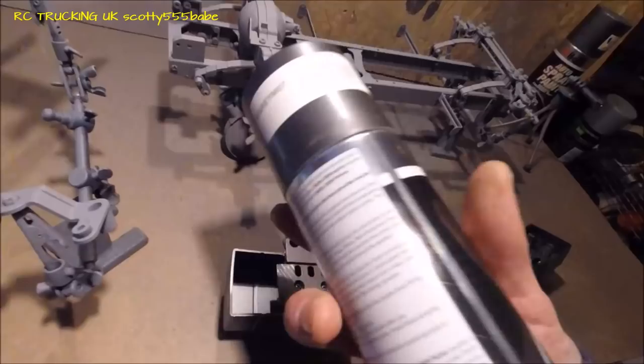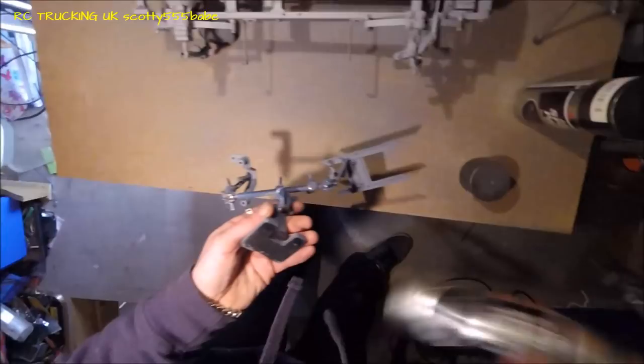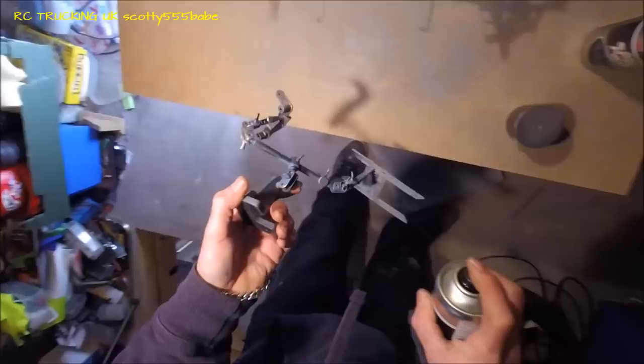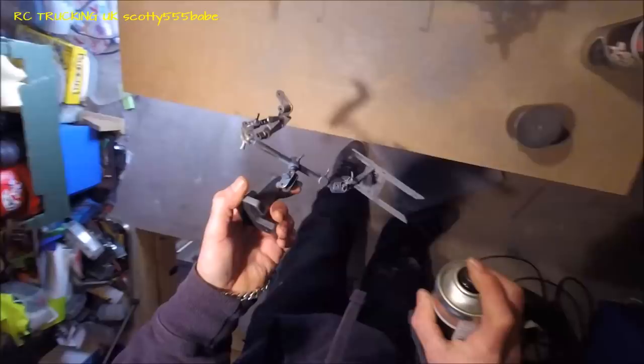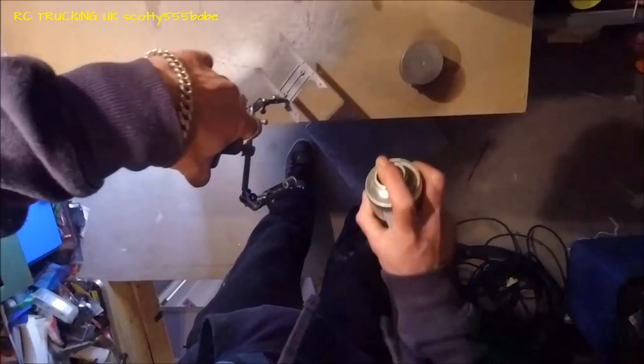This is ready for a coat of paint now. I've just gone under the undersides of the tanks and stuff, and just gone over the top of the gearbox. So I'll get all these painted up now in a gunmetal grey. The regular grey I use — I mainly use just the Holtz spray brand. I absolutely love spraying with them, they're so smooth. When spraying with metallics always want to make sure your cans are nicely warm at room temperature and your paint's warm and well shaken up. I'm just going to blast under these. This is the underside — you don't really see this — but I just like to know it's all done. You can see I'm not going on heavy, just letting it build itself up.